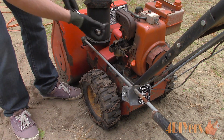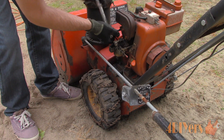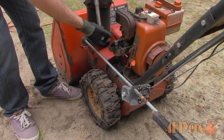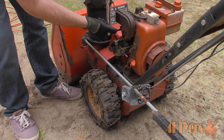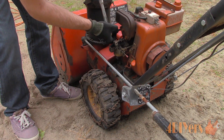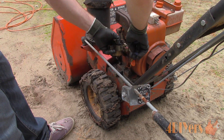The bolts fastened to the engine block, if they haven't been removed for a while, can sometimes be seized. Here I'm using a hand impact driver which provides some shock to the fastener while performing a twisting action. This also greatly reduces the risk of stripping the phillips screws. Remove the fasteners fully. You may find the carburetor or intake manifold is stuck, which is fairly normal — just apply a little pressure and it'll pop right off.